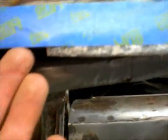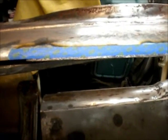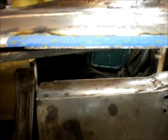Okay, so I've taken a piece of tape, laid it across there. I've left a gap for about the thickness of the sheet metal, and it goes from there to here, and I've double checked it with my metal ruler, so it is indeed straight, and I'm going to trim that. I want to debate whether I'll use a cutting wheel or hand shears. We shall see. Alright, so I've opted for the hand shears.